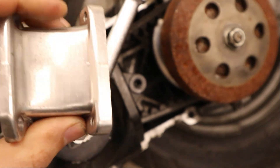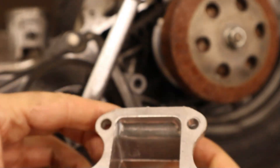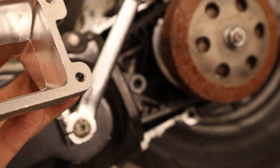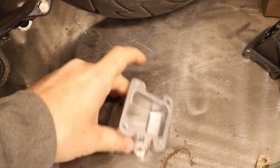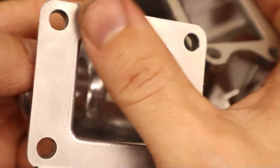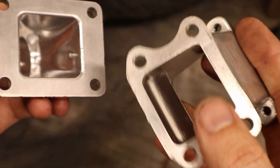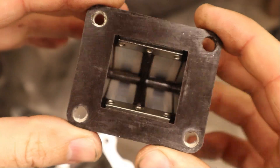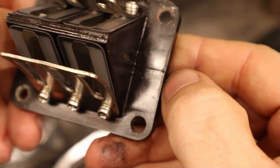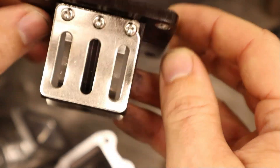These are great — don't get me wrong — for $20 it gives you a pretty nice reed block, but these are kind of junky. They have a tendency to blow apart and you need to do a bit of pre-finishing. Get yourself a piece of sandpaper and a flat surface, like the metal bench here, and just lap it on there until it looks like this one, which has already been lapped and cleaned up. All the machining lines you see on the unlapped one are gone. You need to do that to all three mating surfaces, using 400 or 600 grit sandpaper.